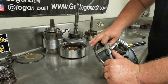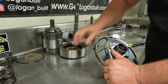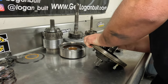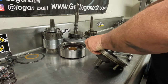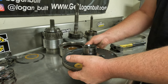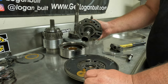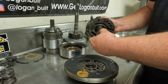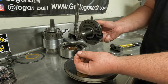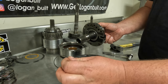Somebody wanted some of these bolts not to go anywhere, and other ones were just normally tight. Once you remove all the bolts, you can just push down on the stator support and it comes out. You're going to want to take this converter sealing ring and throw it away — we don't run these on any of the DIY kit stuff.